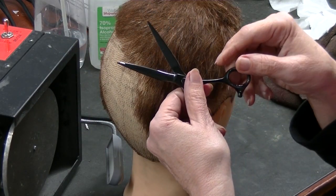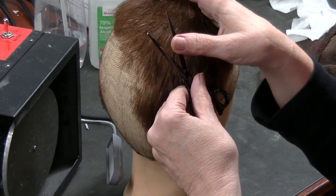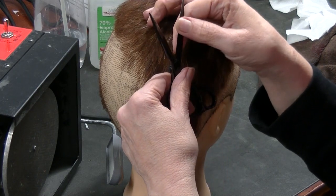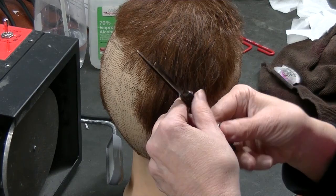When hair folds, it's going to be due to a loose screw — and we just tightened the screw, so that's not it. Or it could be the shear is out of alignment, or it could be it's just not sharp enough. When I put my thumb here, I'm not feeling that sharp of an edge.